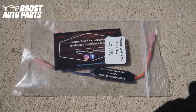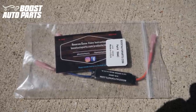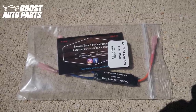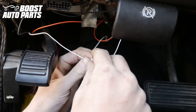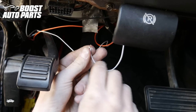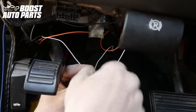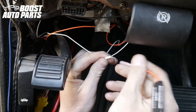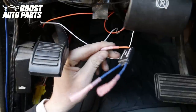Now if you did buy mirrors set up for dome and reverse, you would have received this harness. Inside the bag is a little card which has a little bit more of an in-depth install video — we'll go ahead and show you in this video as well, however you can reference back to that video if you have questions. If you did not purchase reverse and dome, you're done — go ahead and skip this portion of the video. Now we're taking the two white wires that go to each of the mirrors — the left side and right side wire — and we're going to go ahead and twist them together. We're putting them into the single orange output on the dual-function dome and reverse module, and we'll go ahead and crimp that down.